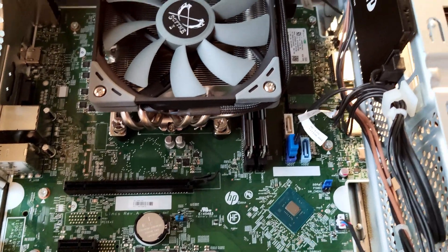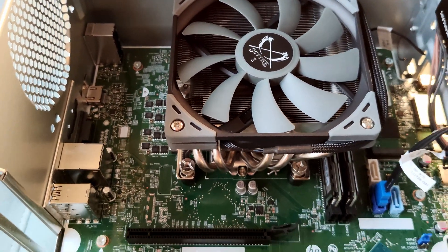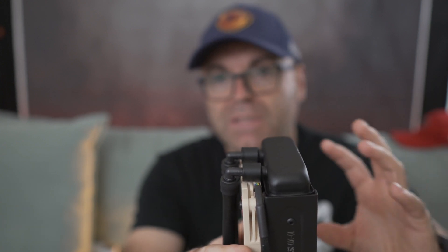Going in and buying this, I factored everything and followed the logic of what was going to happen. The way this case is constructed for the HP computer, it only has one exhaust point, and that exhaust point is currently populated by a 92mm fan by Foxconn, PWM controlled by the motherboard. This 92mm fan is solely responsible for exhausting all the hot air from the CPU, GPU, NVMe drive, memory — everything. When you install this AIO, you replace that fan with the radiator.